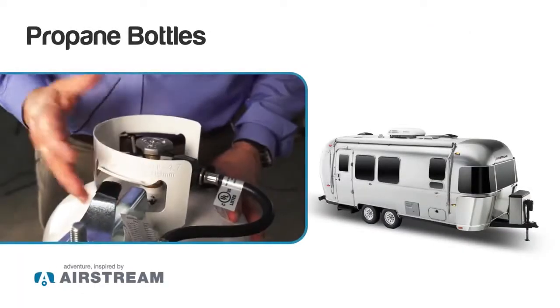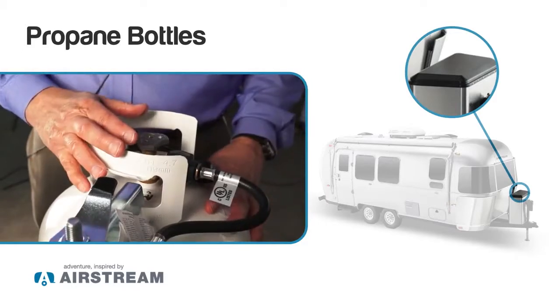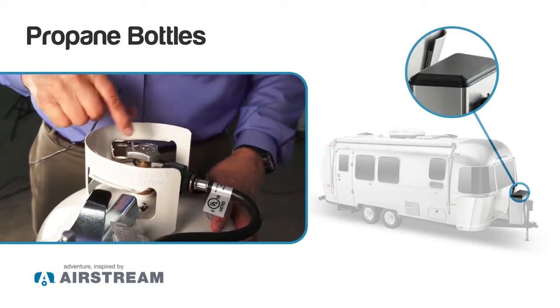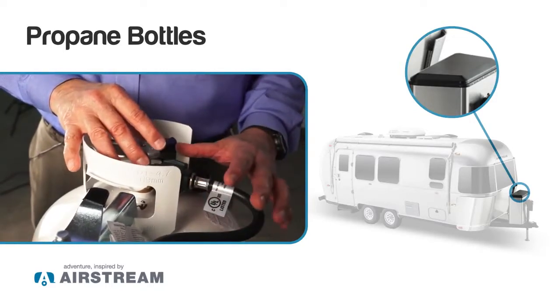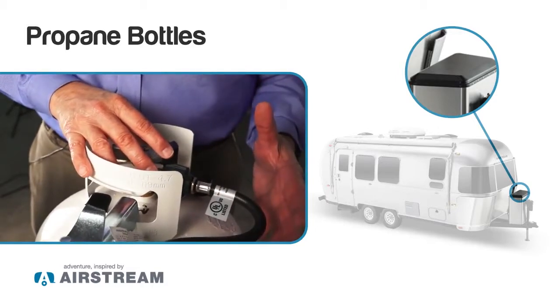Next we want to cover the propane bottles. We're going to start out assuming your bottles are full. You want to go and turn on the little knob on top of there. It has an arrow pointing which way to open that up. You want to make sure you open that up slowly because it has a protection device in it that will shut the system down if it detects a large surge.